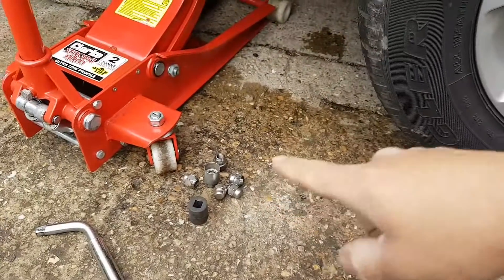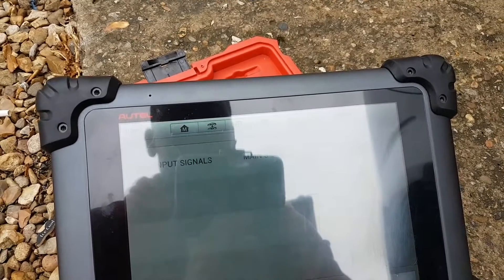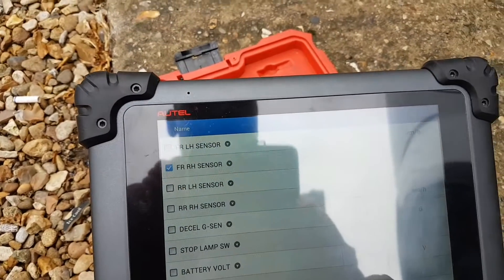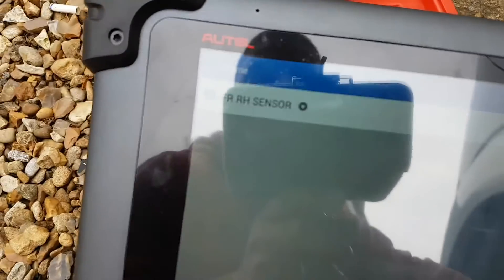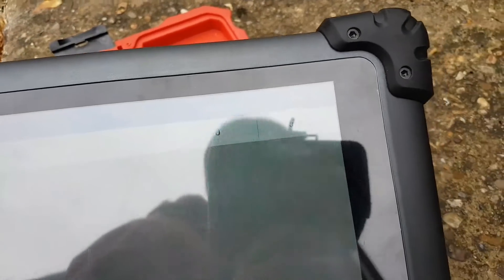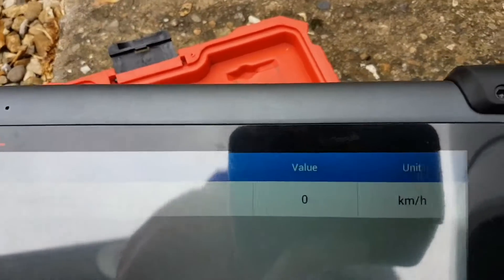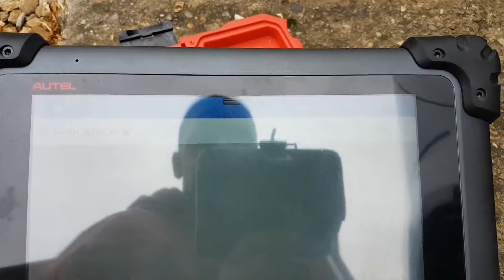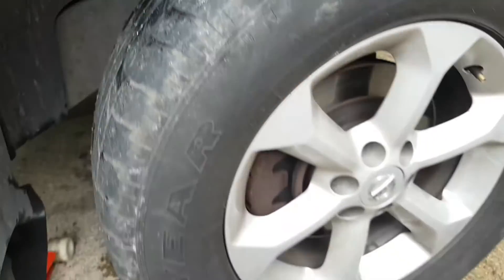I hope the wheel is not going to fall off — I have most of the nuts already removed, but there's one still in there. So what I'm going to do now is go to live data. I spun the wheel — no fault detected. I'm going to live data. We have input signals — front right end sensor. I'm going to spin the wheel by hand and I get nothing. It's difficult to spin the wheel but there is basically nothing from this wheel. The cable looks like new, so it looks like they actually replaced the sensor. Let's remove the wheel and have a better look.